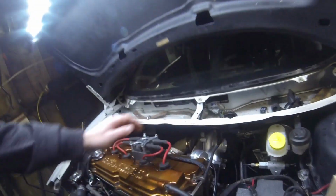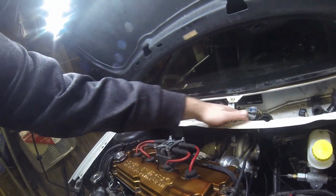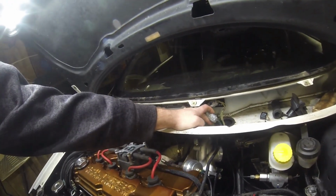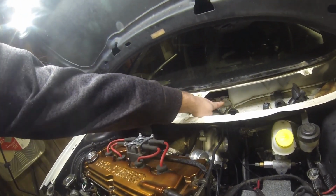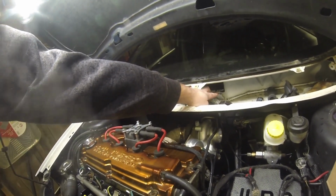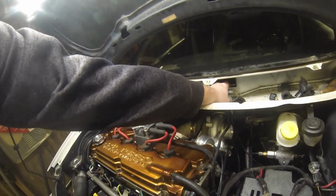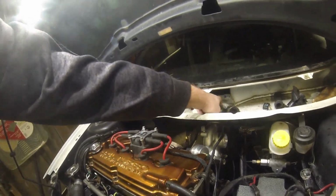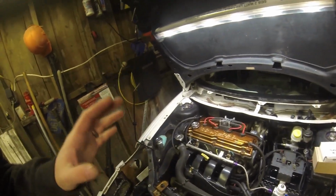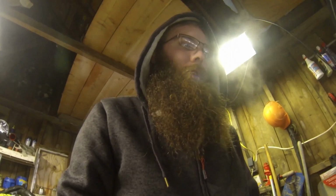And I just got tired of messing with it, so I took it out, and I ended up just getting some standard connectors here, and I split them off. So like this one here is for the boost box. This one does the tip sensor and the boost solenoid. This one is for the watt box and other sensors that feed for the watt box or the boost box as well. So when I do the engine harness, I can unplug this one. This one's for the body side. So whatever I have to do, I can split it. I'm not trying to go deep in a connector to split everything, like I said. Try and make this vehicle as service friendly as I possibly could.